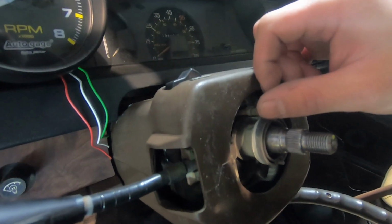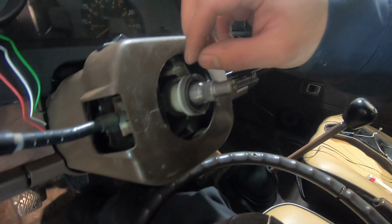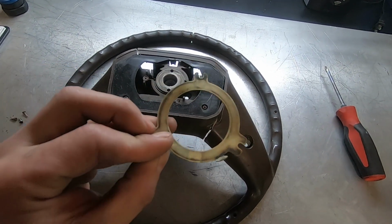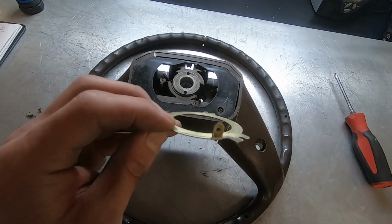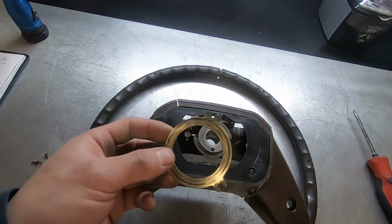The other way I've seen people have found is a cap for this guy, and just put a cap over it to take up some of the clearance, and that has worked for them. I noticed when I unbolted this guy off, there was that green oxidation stuff on the other side, so I got that 400 paper and I cleaned up the other side. If this is full of oxidation, this could be a point of high resistance too, so yeah, clean up this guy too.